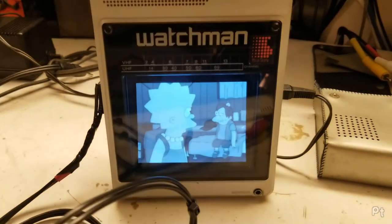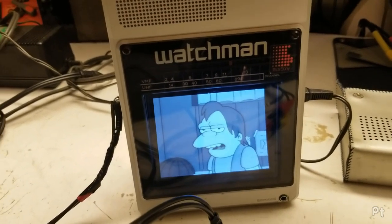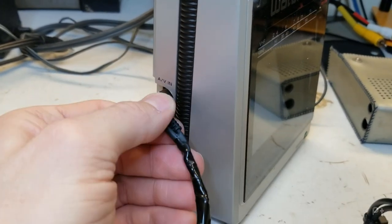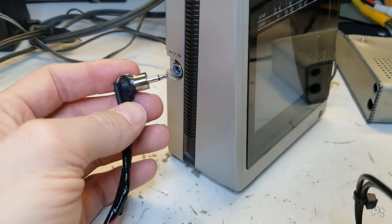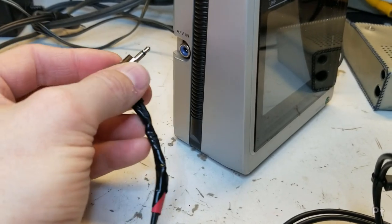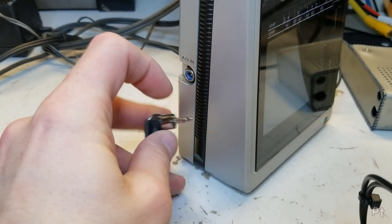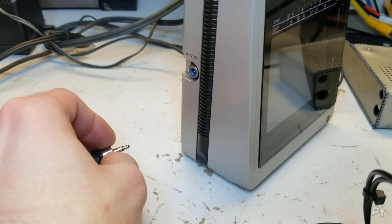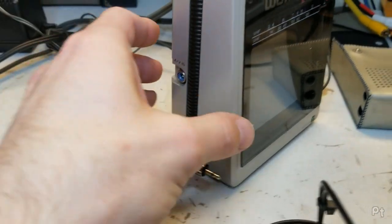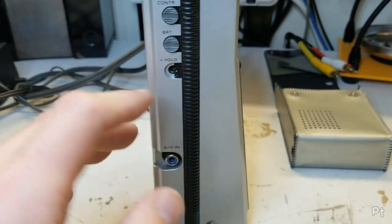I take this and plug it into the side — I had to reverse the cables because I hooked them up backwards — and there we go. So yeah, I can get a proper line-in on this. It looks janky but I've been using these quite a bit and they're holding up just fine. It's hard to unplug and plug in one-handed — this connector has a lot of grip, being that it's both the 3.5mm jack and the outer sleeve. Usually it's just the outer sleeve that holds the connector in, so you have two methods of retention kind of fighting each other with this implementation.